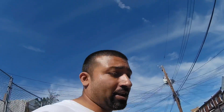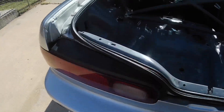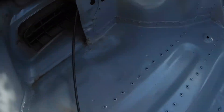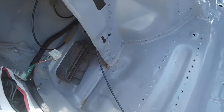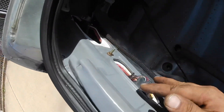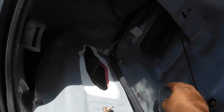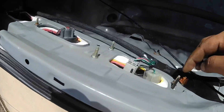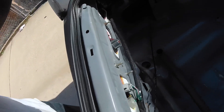Next up, I've been noticing there's been some water on this side. I don't know if you can see the ring of black color on the paint — the water's been accumulating right there. I believe it's from this tail light gasket. I sprayed the car down with a hose and I can see some water leaking down right here, so we're going to remove the tail light. It's a bunch of 8mm bolts.